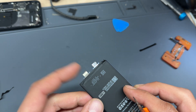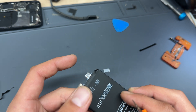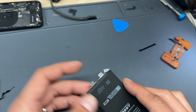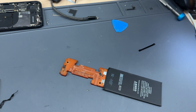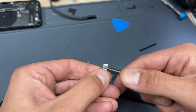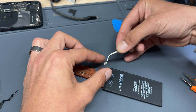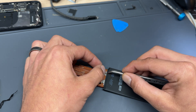The terminals on these — one is nickel and the other is aluminium. The aluminium one is very soft — that's the positive, the anode. If you start welding that, it'll just blow and turns into nothing. The easiest way to get around that: some batteries like the Xcap ones already have a little nickel strap attached, but if yours doesn't, it's very easy to get a small piece of nickel plate, cut it down to the size you want, place it onto the terminal, and then use the welder to secure it into place before securing it onto the BMS.